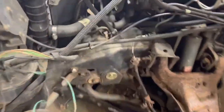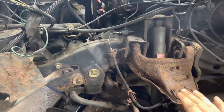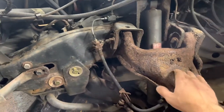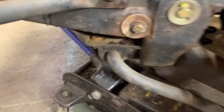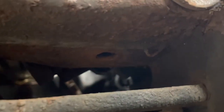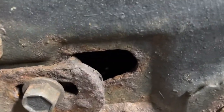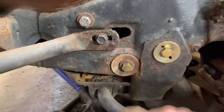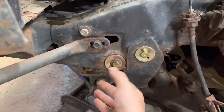All right, we got the tire off. So now you can sort of see what we're working with. These control arms were new in what would have been 2015 - you can see all the paint has come off and they're starting to corrode, so we're going to have to do something about that. Some sort of cancer spreading around here. If you get closer here, you can see the rust down in there. You can see light through it, so you can imagine how thin the bottom of this is getting. The plan is we're going to pull these back off and pull this bumper brace off to get it out of the way.